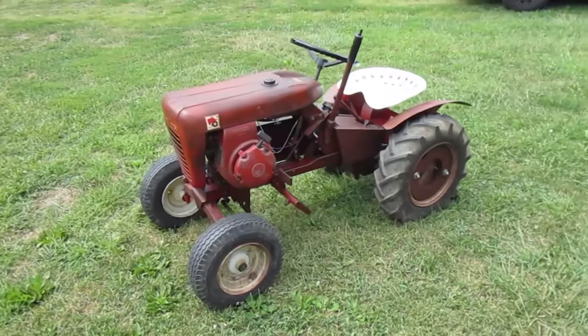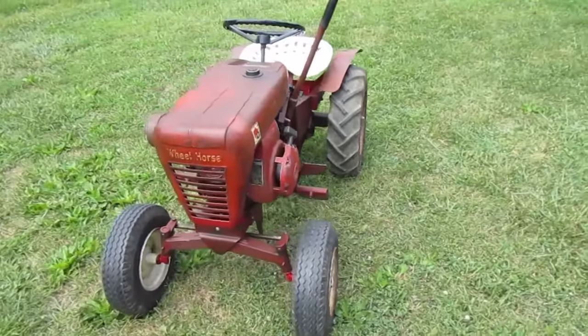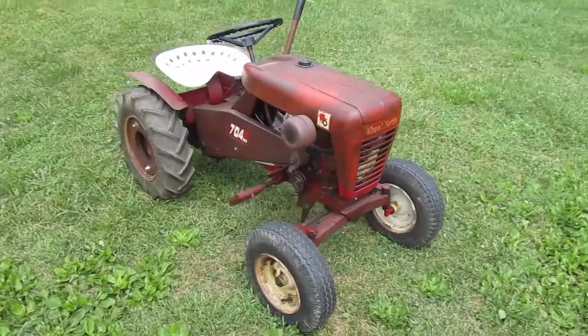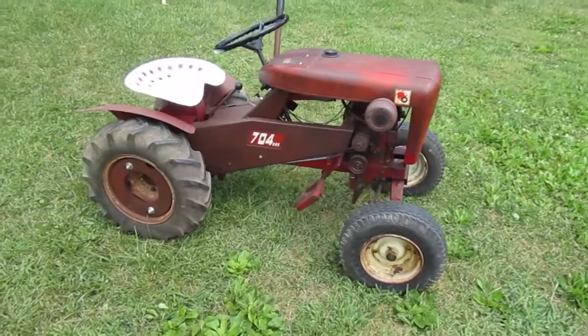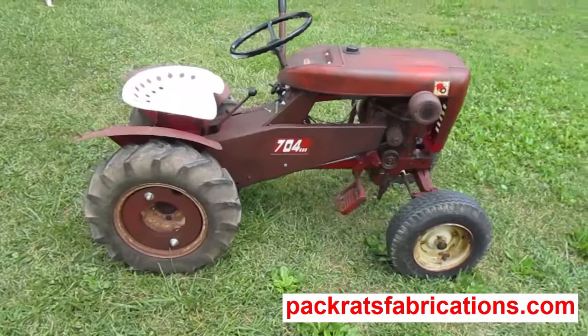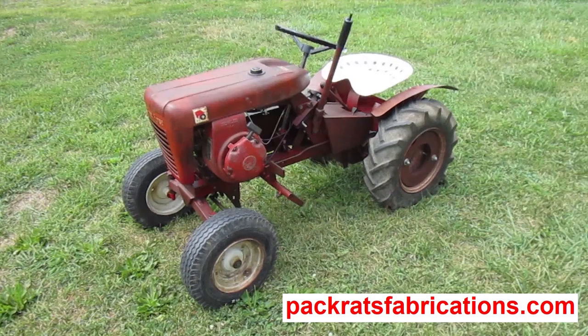Well, that's as far as I can go with this one, and I'm not sure what I'm going to do next. If I can't find a good side plate with a good bushing, maybe I'll try to repair my old one. Or I think I can change to a roller bearing side plate if I change to a different crankshaft. Alright, that's it.